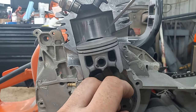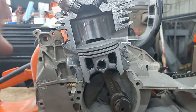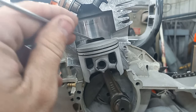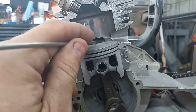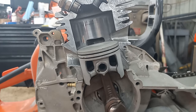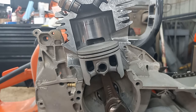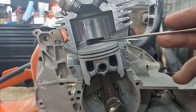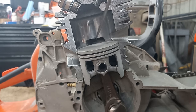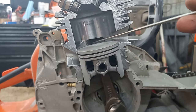...it will actually force an exhaust charge right down your transfers. I'm sure you guys have torn saws apart that are pretty old where all inside here you've got all kinds of carbon and residue inside your transfer ports. A lot of people think that's from blow-by, but if the saw has good compression it's probably not. You can get blow-by, yes, but typically blow-by will contaminate all the way down in here too. I've torn many saws apart where they've had black residue inside about halfway down the transfer port — that's where the reversion happened, pushed it down about halfway, and then the exhaust gas pressure dropped enough to allow it to come back up.